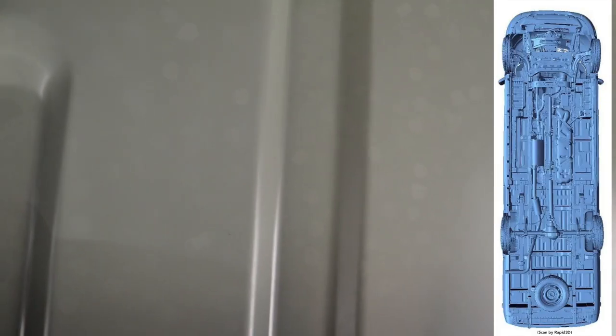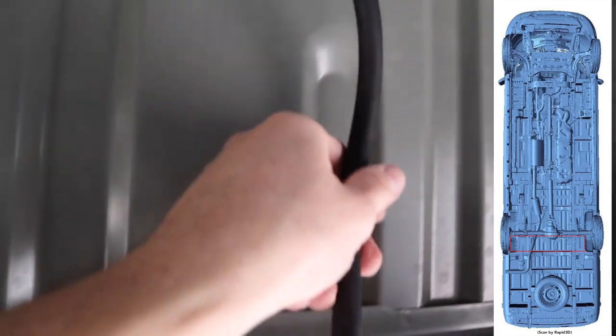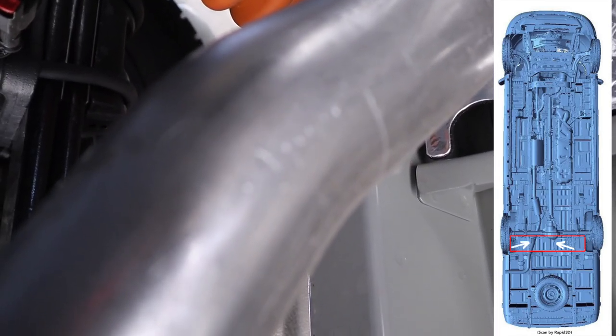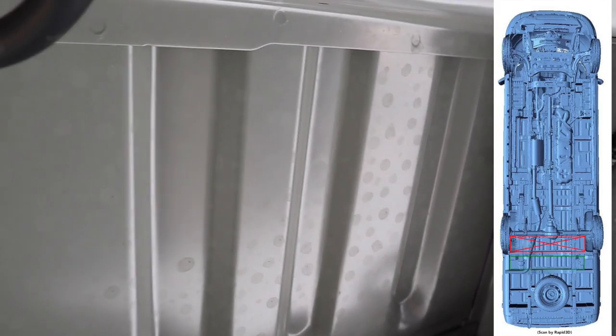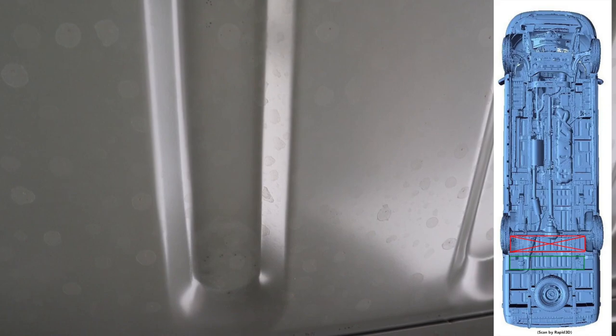Here is the rear differential. There are two spaces you could probably mount this. The first is directly behind the rear diff, but I don't think I'll opt for that because of the cables running through there — it would be a tight fit and it'd be bumped up right next to the exhaust. I'm going to opt for this space instead. It's pretty clean, not much going on. There's plenty of clearance from the spare tire, and from my measurements the propane tank will hang down just about an inch past the spare tire. The rear differential hangs down lower than the propane tank, so hopefully it will act as protection for the propane tank.